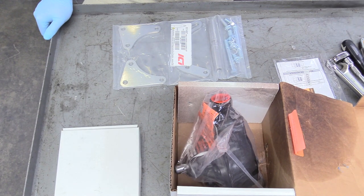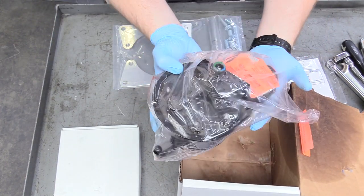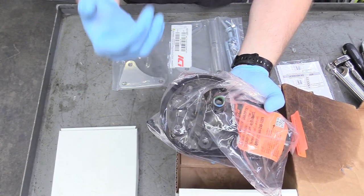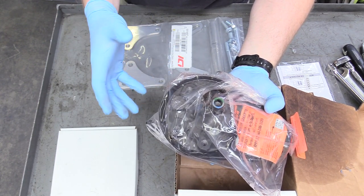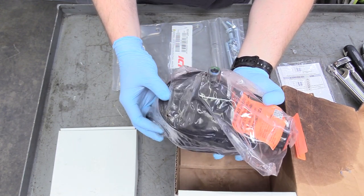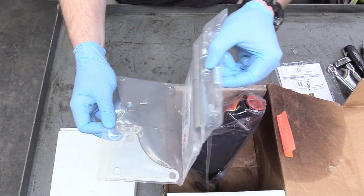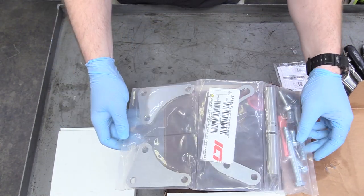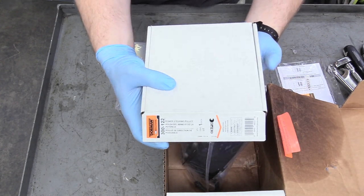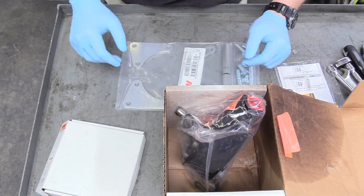So what you're seeing in front of you is basically our suite of parts that is going to put our power steering pump on our engine. This is our unit — it is a press fit for the pulley. This is the older-school way of doing things where the pulley is actually pushed on; on the newer stuff it's a bolt with a key way. So that's how you can tell the difference between your newer pulleys and your older ones. This is our bracket system from ICT, just like our alternator. I bought these basically as one set — we know the power steering is going to be located in the bottom right and our alternator is going to be in the top left if you're looking directly straight onto our engine. And you have to buy yourself a press-fit power steering pump pulley like this one from Dorman. All the links for everything are located down below in the description.